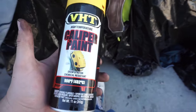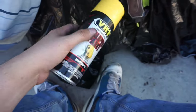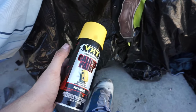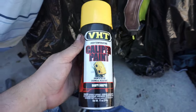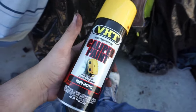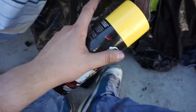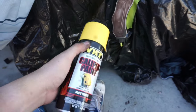So this is the paint we're gonna be using — it's the most common caliper paint, the VHT. It's the one I've used before. On my Roush, the back calipers, I used the same VHT — they have a couple variety of colors. It has a semi-gloss finish, but I'm still gonna hit it with some high temp clear coat. I also got something to put in that big blank spot on the caliper — a little trick I'll show you guys later.